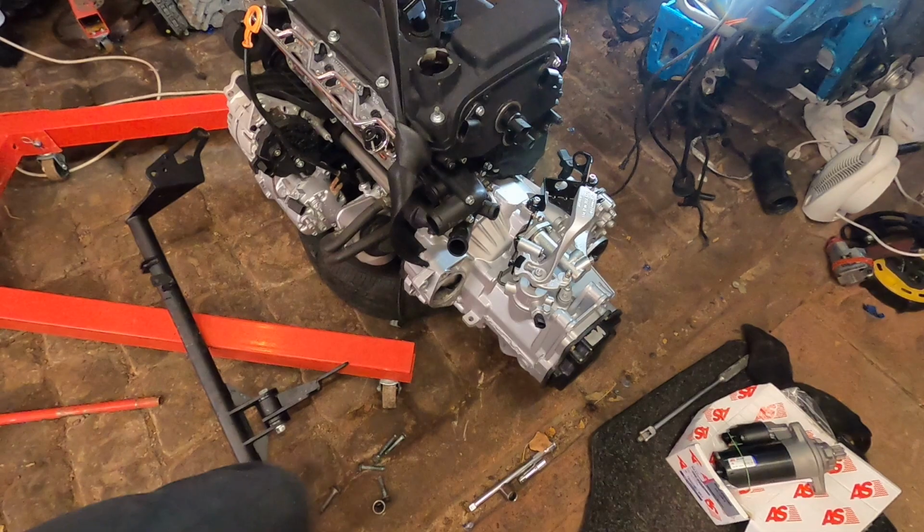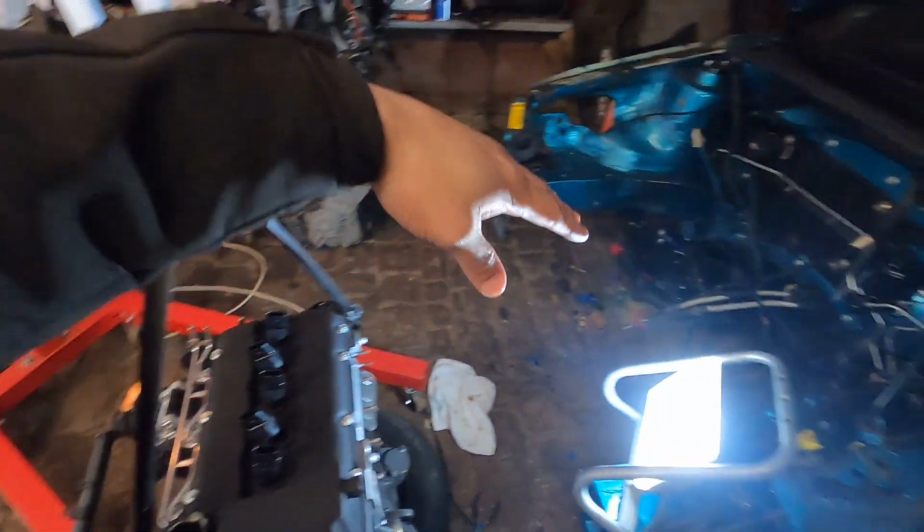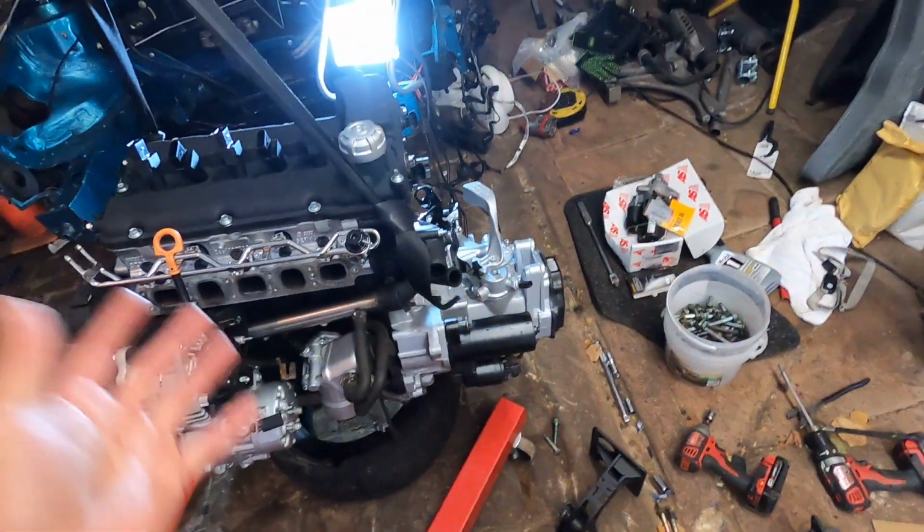The transmission is now on. I'm gonna go ahead and put the exhaust manifold on while I have all this room to work, and also set the down pipe and stuff through the back section there. Starter is now on, new belt is on this side, exhaust manifold on, headers are in. All we have to do now is grab the Fabless mounts. This one for the rear, that one for the trans, and she's going in, and then once she's actually in there, we can bolt up the tubular cross member and actually set it down.